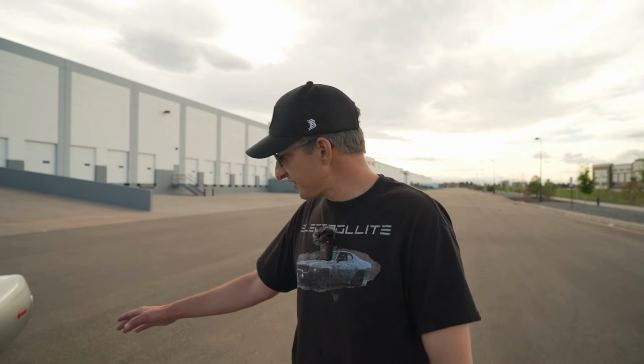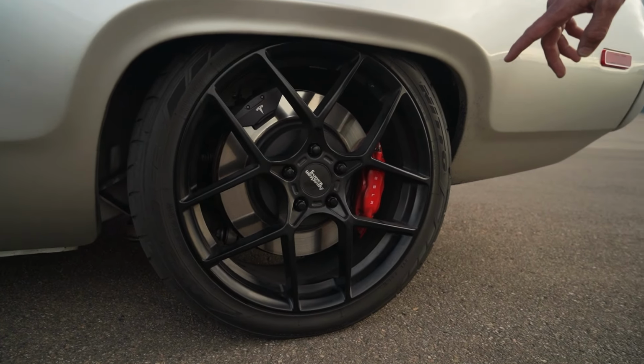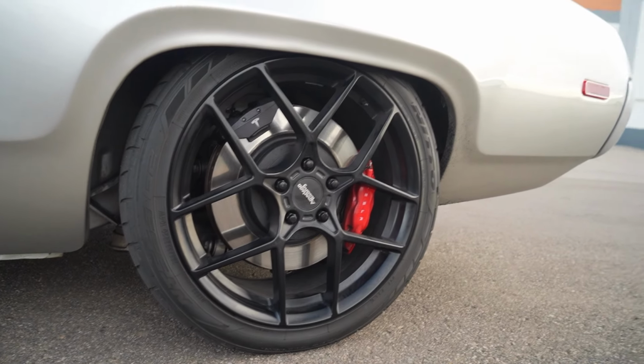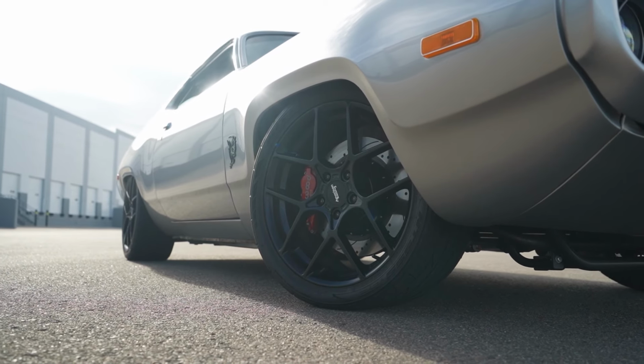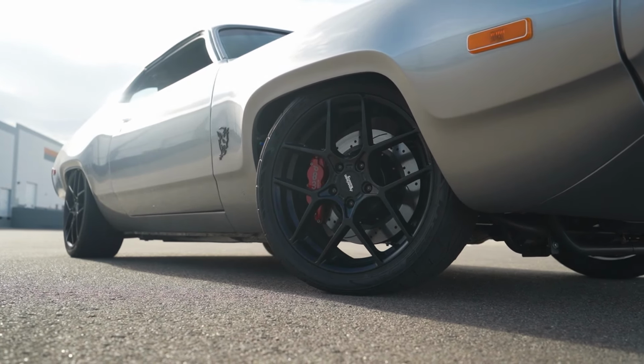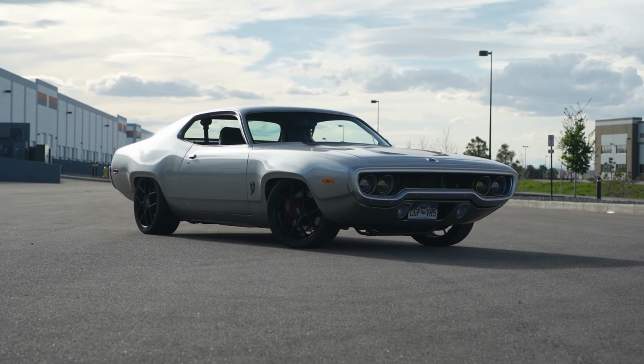Thank you. I used an entire Tesla subframe, so from brakes to brakes, that's all Tesla. You're kidding. These are on the ludicrous cars, and that's a 14.3-inch rotor. What I wanted to do was make it match in the front, so I put 14s in the front. And to get the picture right, I've got 20-inch rear wheels and 19-inch front for a little bit of stagger. 285s in the rear, 275s up front.